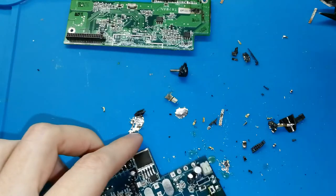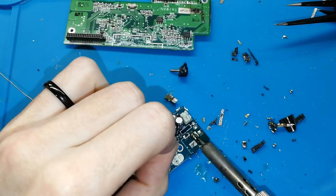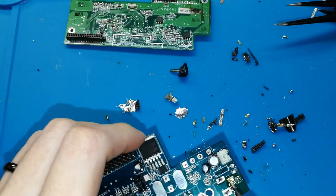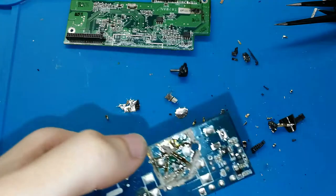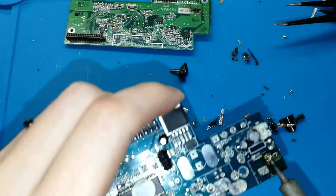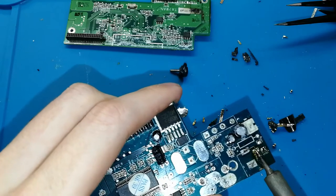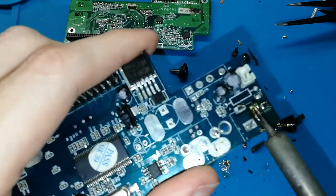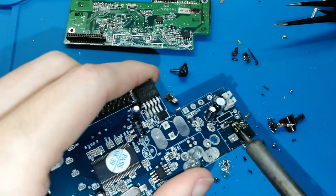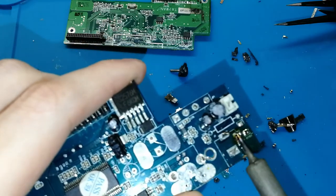I will repeat, okay? I will put tin to fill the hole. Okay, you can see it's not hole anymore. I close very well, and now keep here. I don't know, 5 seconds. I think it's enough. Maybe 10, and then get up your board with your iron touching. You have to touch, keep touching, and then hit the table very fast and a bit strong.